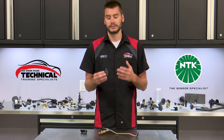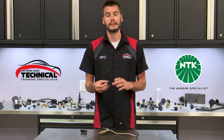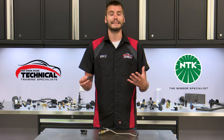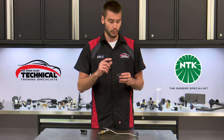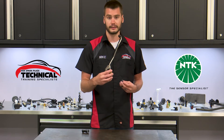The engine computer then opens up your wastegate accordingly to bleed off that extra pressure. To replace this sensor, it's generally not that difficult of an installation procedure, but getting to the sensor can prove troublesome. It's going to be mounted somewhere in the tubing between the outlet of the turbo and the throttle body — it could be down by your intercooler, or it could be really easy and accessible from the top. It all depends on the vehicle, but the actual installation usually involves just one or two bolts, or a clip.